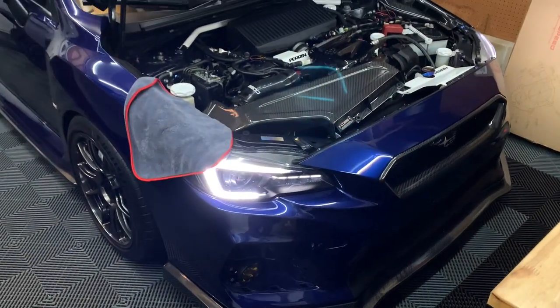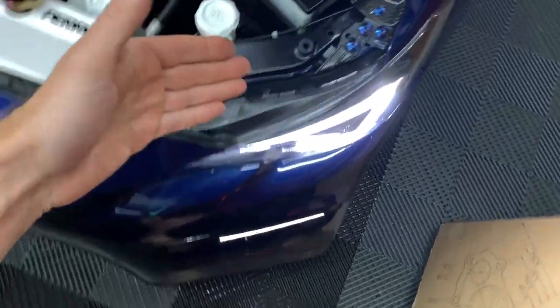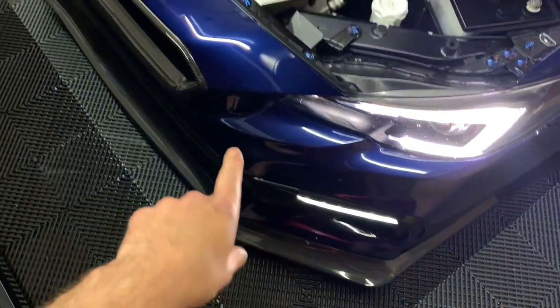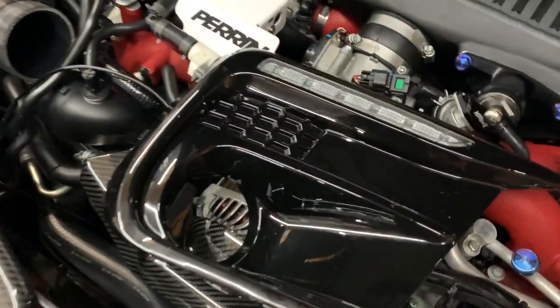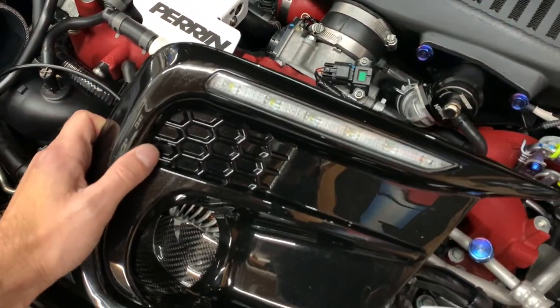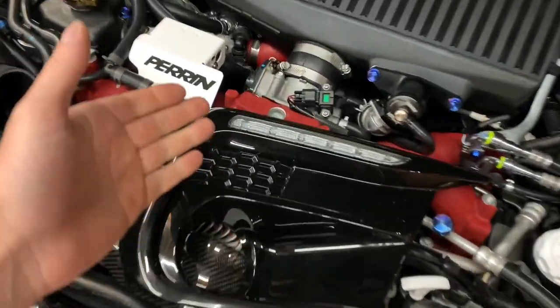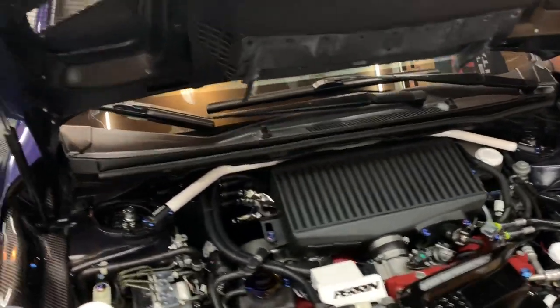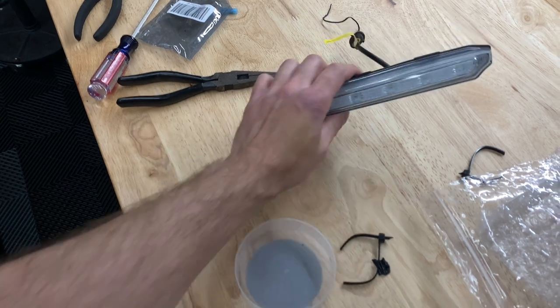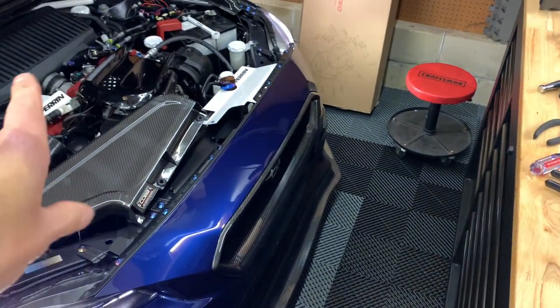So this is how I had it wired up. As you can see, the C lights are on on both sides, everything is working. And then down here the strip is working just fine. I don't have the passenger side in because I'm doing some testing, but this is what was happening — you can kind of see it flickering, obviously it just is not working correctly. I thought maybe the LEDs were going out and then eventually it just stops working. So my logic behind it was the LEDs are dying, it's just not working, something must be wrong. As I mentioned, I got a replacement from SubiSpeed thinking that was the issue. So I'm going to plug that one in to the harness and I'll show you exactly what happened.